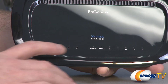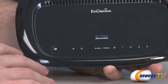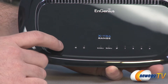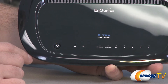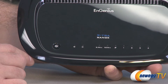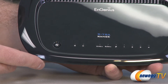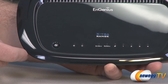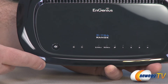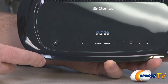On the left side are the final buttons. This is a WPS button and indicator light, and it can actually serve a few different purposes. You can press it for one to five seconds to activate WPS setup, which you can use when initially setting up your password. If you press it for six to ten seconds it will automatically reboot the router. And if you hold it for 20 seconds it will reset the router to factory defaults.